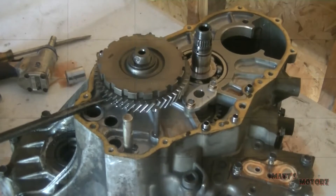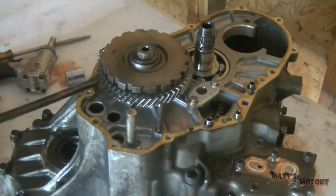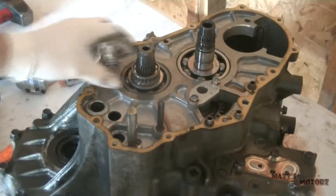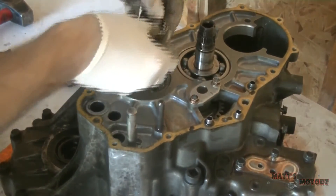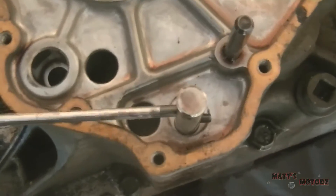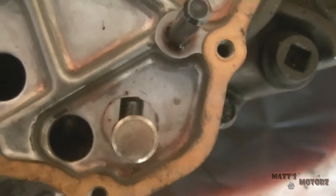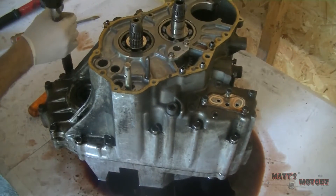You don't need to press — all you need to do is pry up on it and then let your hammer drop gently on the top. Don't hit it very hard and it will pop up. You don't need a gear puller. So that was the park and countershaft first gear. Get the needle bearing that's underneath of it. You have to move the gear selector so that little notch is in line with that hole right there — that's so the case can come out without getting stuck.